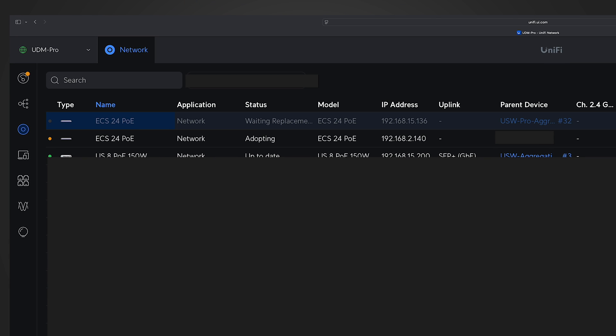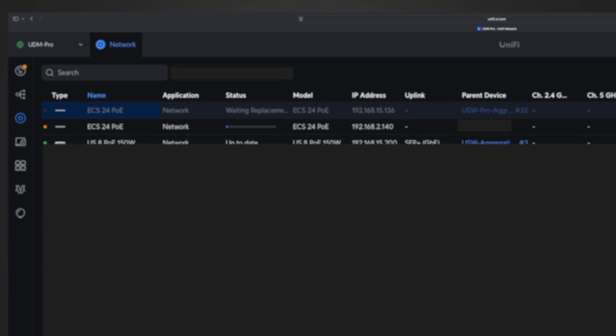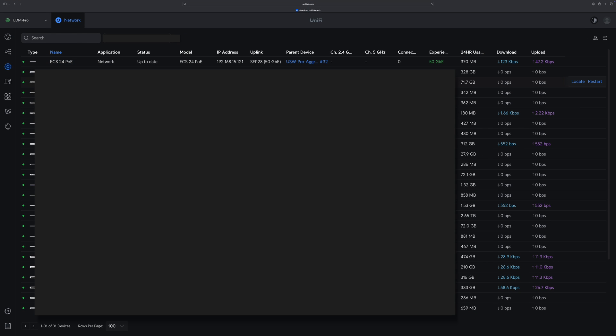This way, I'm able to make the system recognize the replacement device and adopt it. Now I powered on the replacement switch — I was not asked with a dialogue asking whether I want to adopt the switch. The system automatically adopted it, because it already knew the MAC address of the replacement switch. After the new switch is adopted, the system will automatically configure it with the configurations from the old switch — everything is automated. What I need to do is just reconnect to the uplink switch with link aggregation, since those configurations are already there.